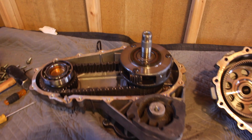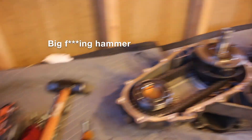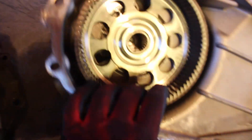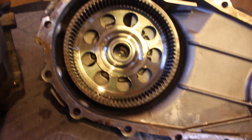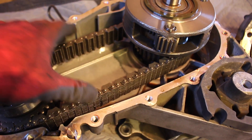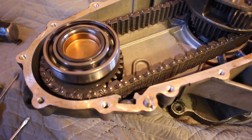And there we have it — cracked this thing open. I needed a little bit of help from my good old friend, BFH. That's the inside of the 214,000 mile transfer case. And actually, if it wasn't for that bad output spline, I would reuse this. All the gears are really nice, everything looks to be really clean in here. This thing has aged well. But check out that chain slack — that's what you don't want to see. That is a loose chain. All the bearings feel great though.